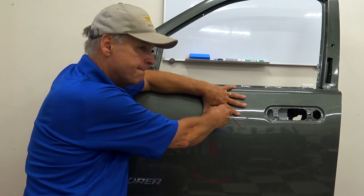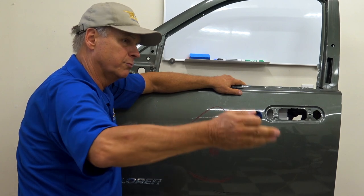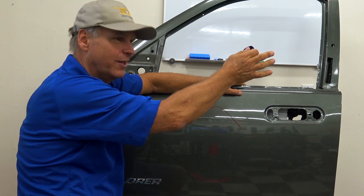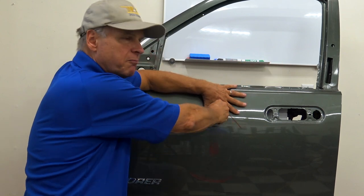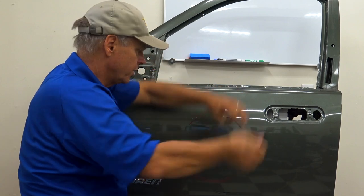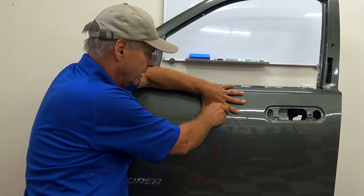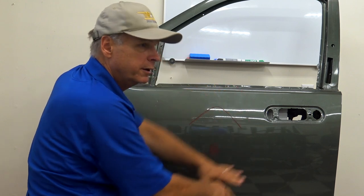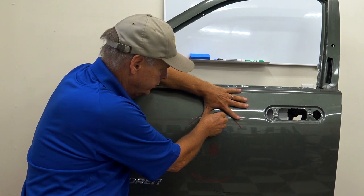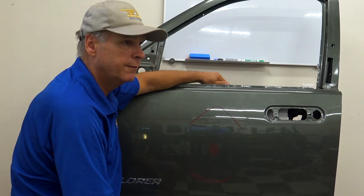And what we're going to do is pull. Hopefully you've got some kind of a jig to put that pressure on, either your truck receiver hitch or a 2x4 mounted to the wall on a high hook. Anything will work. That's right. Just 100 pounds, 150 pounds, and what that'll do, be both hands free, tap it down with a hammer, tap down whatever, and just start working that crown into the dent. So you can work it until the crown reaches that point, we glue it, and usually about 3 or 4 of these max, and you've got that crown worked down.